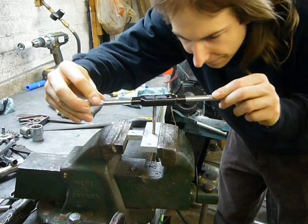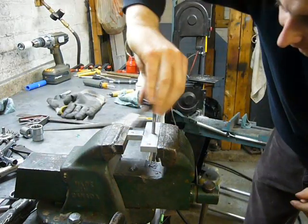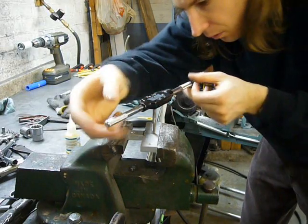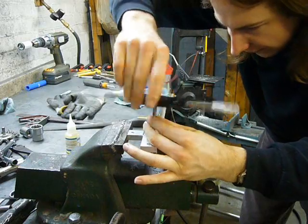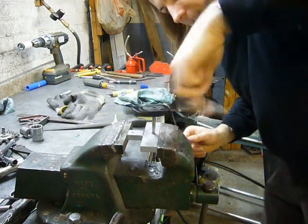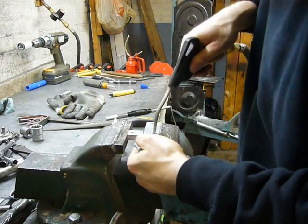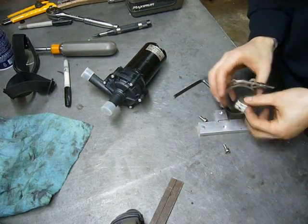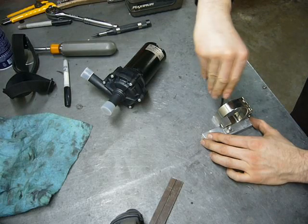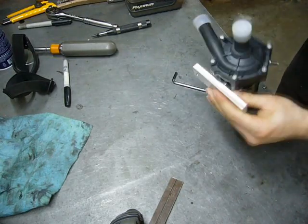The reason I used a tap drill on these two holes is so I can tap them to M6. That's also one of the reasons why this bracket is so thick — I can't put a bolt on the other side because the top hole has to butt right up against the bulkhead on the car. Here's how it all goes together: the pump mounting hardware just bolts to the bracket, then the pump slides into the assembly, and that gets bolted to the car.